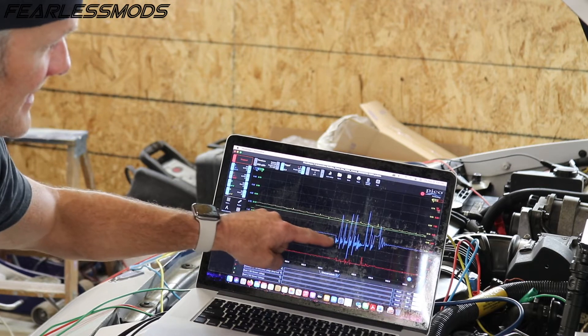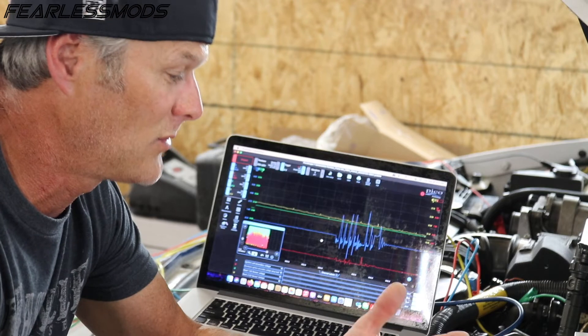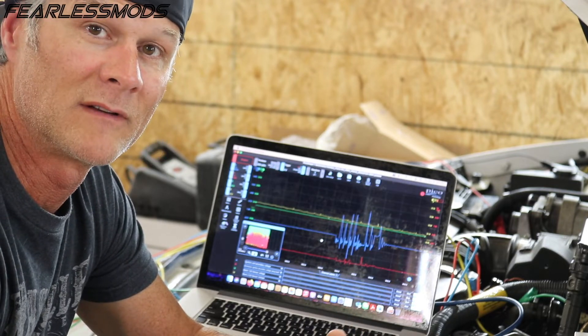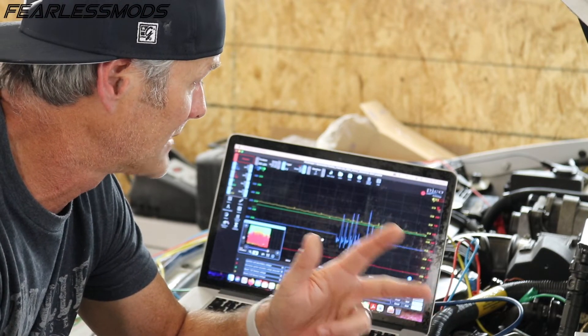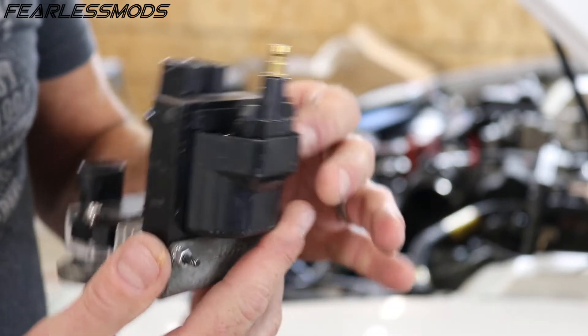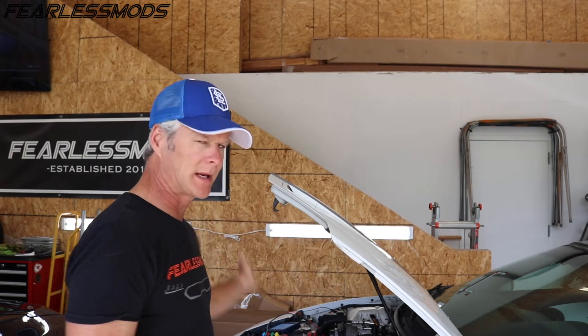Why is the secondary bad? Is it because we've already stressed it out enough by not properly distributing those sparks through the opti? I know that my ignition control module — which I've now replaced twice — appears to be working properly. That would mean I have either a cap, a rotor, or a coil problem. I think I've got it narrowed down to those three things. I might go at the coil first. It turns out I got this thing over three years ago — it's the Duralast cheap version. We're going to upgrade to at least an AC Delco. I replaced the coil — quick, easy job on this car. We'll see if this coil actually takes care of that secondary problem by letting it run and monitoring for any more failures in the secondary ignition system.